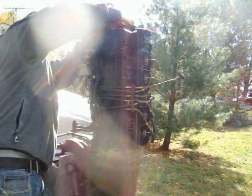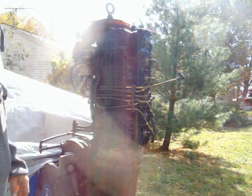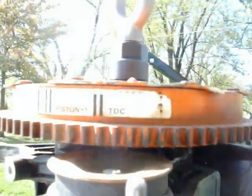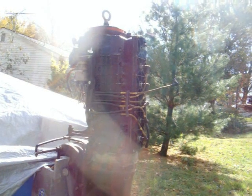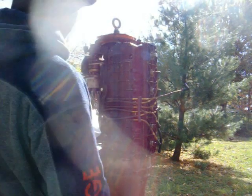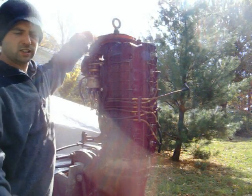Now what you do after that is you spin it the opposite direction — clockwise — rotating the whole assembly until the piston starts to come back up. At one point it'll hit, like that. Now you notate where your three dots are on the vertical surface right here, where this little guy is, and where this little guy is. When all those line up, that's Top Dead Center. What you could do is mark and measure the distance from here to here, find the center point, and that essentially is your Top Dead Center.